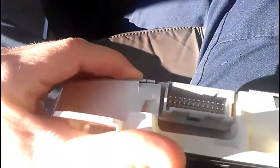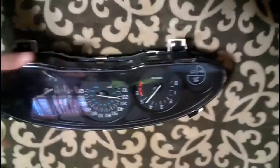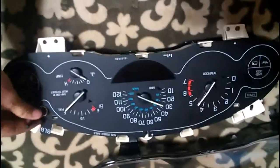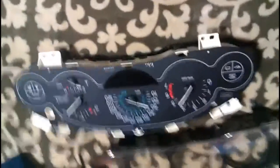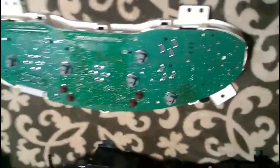Then detach the electrical cable from on top here, and that's about it to get it out. There are just some little tabs that kind of lock this whole thing together — if you push those in one by one and pry up a little bit, that will come off nice and easy. There's a little odometer button, tripometer button if you will. Same thing on the back side — it has little locking tabs to pry off one by one. It comes off fairly easily, and then you have the circuit board. This is the opposite side that we need to work on.